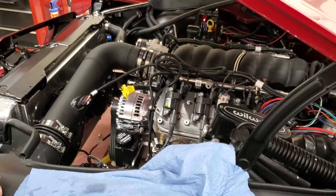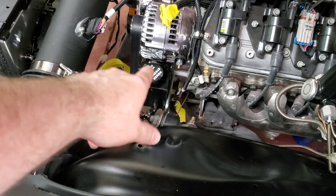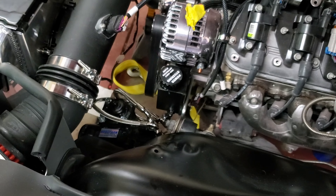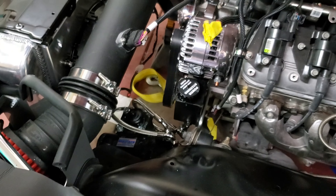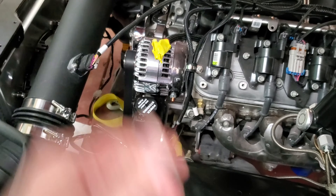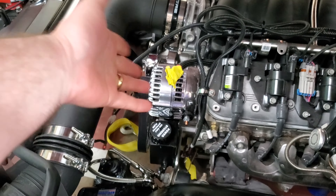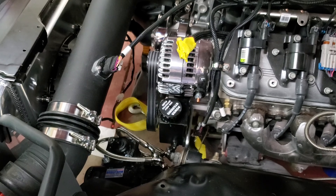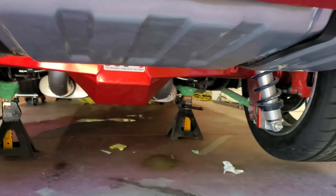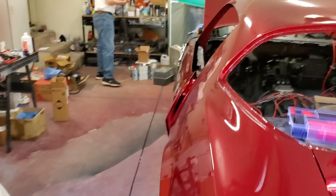We were hearing a little bit of a crunchy noise coming from down here and we checked the power steering fluid — it had pumped all the fluid out, so it was running dry. We filled it up but it's making some awful noises now, so we may have killed it. The other thing is the thermostat never opened up — it got up to almost 200 degrees and then that started happening, so we turned it off. The lower cooling hose was just at 70 degrees, so it just never opened up. Maybe it would have been okay if we let it run a little bit longer. Anyway, we're going to shut it off here.